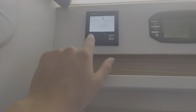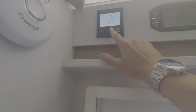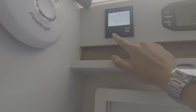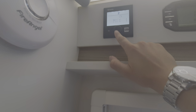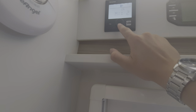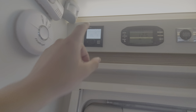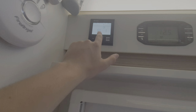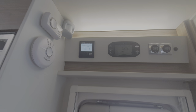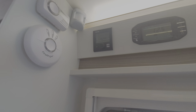Next you've got your fuel — this is probably the most important one, because this is where you can select whatever fuel you've got to the vehicle. So if you've got gas in the vehicle, you can run it off gas for when you're wild camping. When you're on site and you feel like you need a bit more help from the gas, you can run it off mix one or mix two — mix two is a mixture of gas and two kilowatt electric, and mix one is a mixture of gas and one kilowatt electric. Finally, you've then got the option of EL1 and EL2 — EL2 is two kilowatt electric, EL1 is one kilowatt electric. Nine times out of ten when you're on site you'll be running it off two kilowatt electric. The only time you'll run it off one kilowatt electric is if you're not supplied with the usual amount of power, or if it is working very efficiently and it's too hot to run it off that two kilowatt.